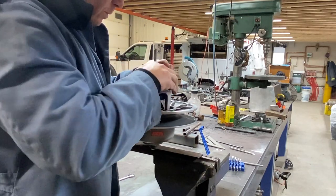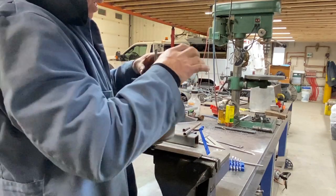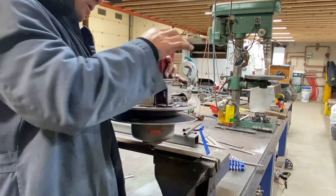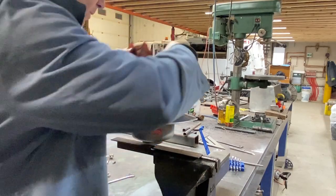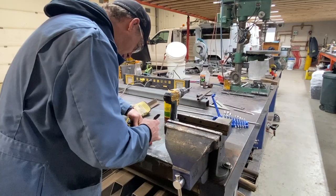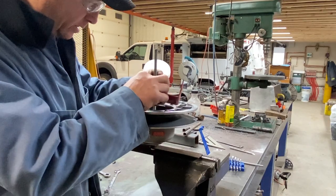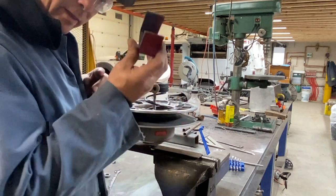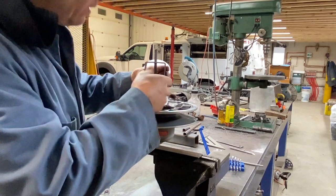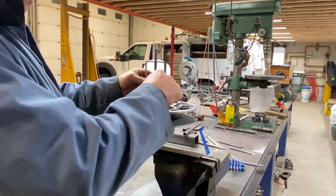And you get so far, the spring is not that tight anymore — you can push down on it. There, all the pressure is gone. Take your nut off, take your little tool off, and everything comes apart just like that. So on the Polaris team clutches, this is fixed, held on with a snap ring. So you go like this — it holds that spider down, then you can take your snap ring off and do the same thing. But you can already have the helix off. So this is what it's going to look like on a Polaris team clutch.